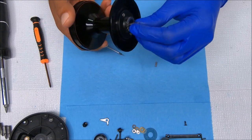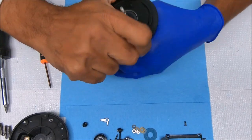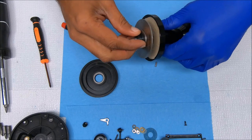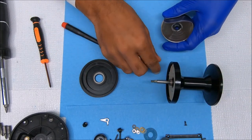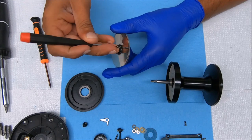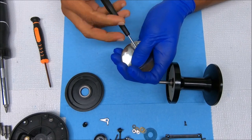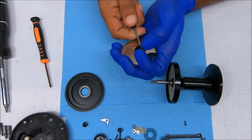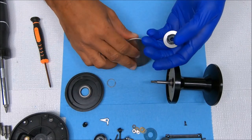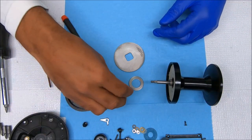Pop it off the notch or the pin that goes through here. To unscrew it you have to just follow the arrow. Now you can pull this off. To get the pressure plate separated you have to pop off this ring that's sitting around it — just gently lift it up, keep your hand over it so it doesn't fly anywhere. Be careful not to touch the plate itself so you don't scratch it. That's the components for the pressure plate.